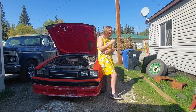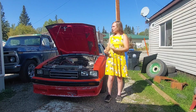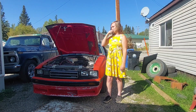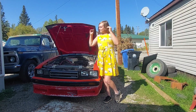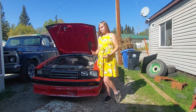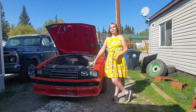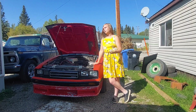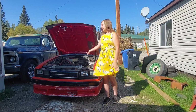And now, the one nice thing about Christopher is that he is letting me put a deposit on it, and then next week at some point I'm going to take the truck up. I was going to potentially do it, not this coming Saturday, but next Saturday. However, I don't know, I kind of just want that back here so I can make a little bit of content on tearing the motor down and seeing what's all been done to it. I want to check out the crank as an example. And it's a 65 engine, so it's actually a different bell housing pattern than this. Even if it didn't have a cracked block, I wouldn't be able to utilize the block of it. So, just the head, that's fine.